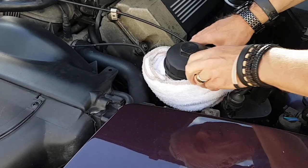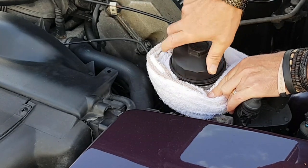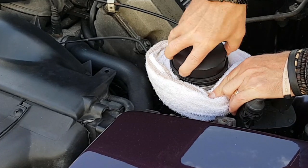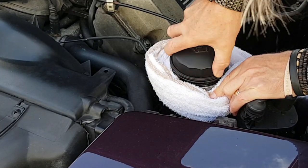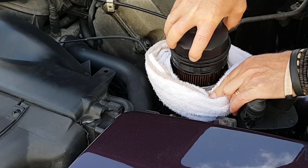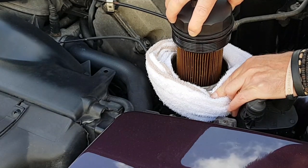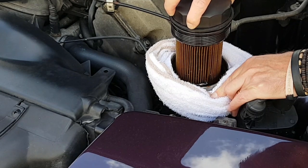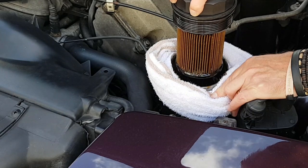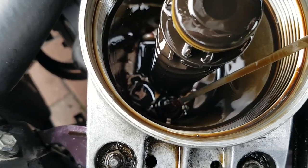The filter won't come out with the lid, and as you take the lid off, oil will come flooding out. Don't push the lid back on again because it throws the oil out even further. Just take it out slowly, be aware the oil might come out, and don't push the lid back down. As long as the filter is still stuck in the lid, all's well. Slowly pull the filter out and have a container nearby — just take your time and let as much oil drip off as possible.